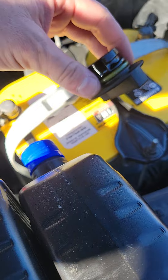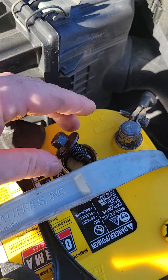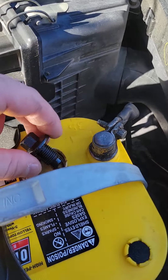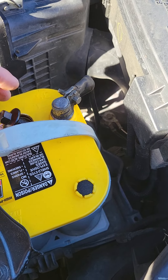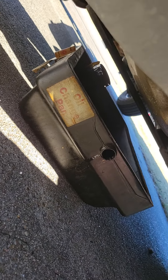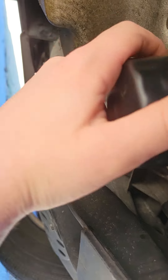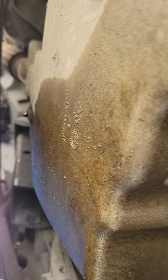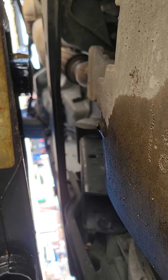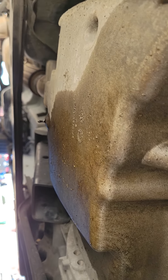First you want to take your cap off — it's right here. Then you have a plug down there called an oil drain plug. It'll look like this; they come in different sizes, shapes, and fashions. For instance, Toyota has a plastic housing. Now when you look up underneath here, I've got it dripping already. I've got my filter here — I've already changed it. You just unscrew the old one, screw the new one back on. Right in here, facing this direction towards myself, that's where the plug goes. Screws clockwise to tighten, counterclockwise to loosen.